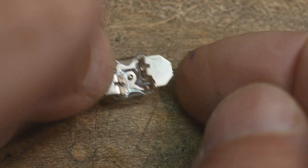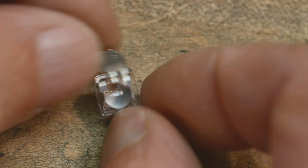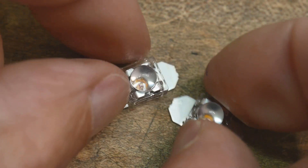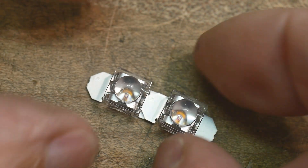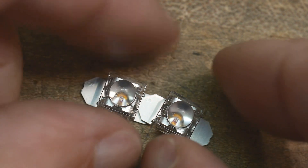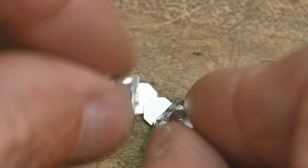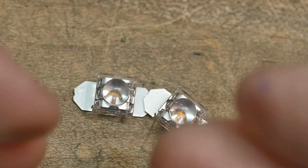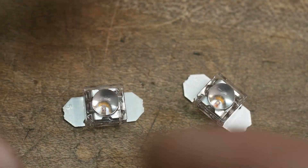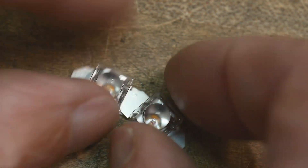This one has big fat legs, and it's meant never to have solder - it's meant to be welded. Just like you weld the tabs on a battery, these are meant to be arc welded, tab welded. So there's no solder anywhere in the taillight. You can make all kinds of geometric designs with these things - in lines, in matrix form, in round form. You could just weld these up any way you want to. Sometimes they're actually part of a frame - a bent piece of metal that is the shape of the taillight, and these are arc welded into that frame. That frame is also another part of the conductor - it's a bent metal origami thing.